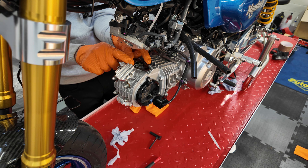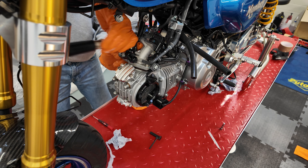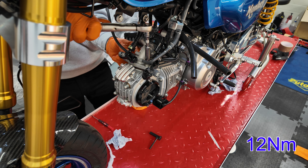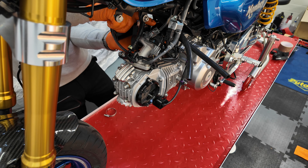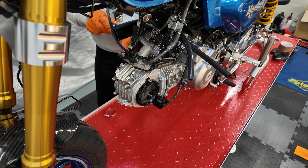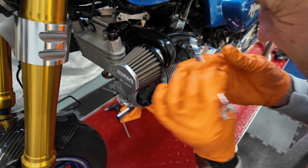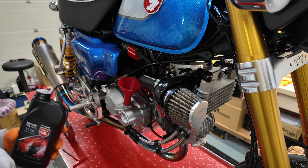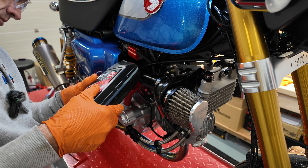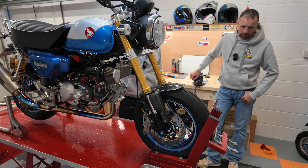Next it's the throttle body — reinsert the gasket, lower it back down into place and use a flange bolt to secure to 12Nm. Then depending on your setup, refit the air box, air intake, oil cooler, exhaust header, etc. Throw some new oil in — as always we'll be using standard Honda 10W40. There's a link in the description for a little 3D-printed screwing funnel which makes life a lot easier.